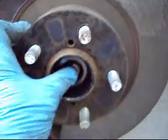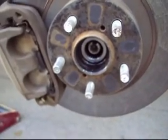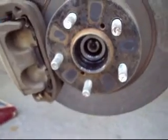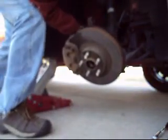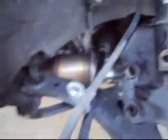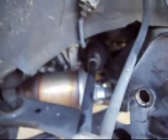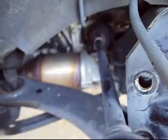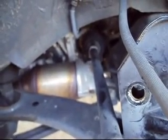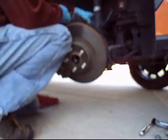Now that that's free, you want to push the axle back out. Sometimes you have to hammer it — the other side I did this morning, I actually had to hit it pretty good with a hammer to get it to back off, but this one seems to be pretty easy to remove. This axle was actually super easy to pull out; it's almost all the way out now. I'm going to pull it down towards the back of the car to get it out. Now that this is free from the hub, you're going to want to line it up as straight as you can, simply just push it in and in a quick motion pull out, and it will release the end of the CV axle from the differential. Sometimes it takes a couple tries.